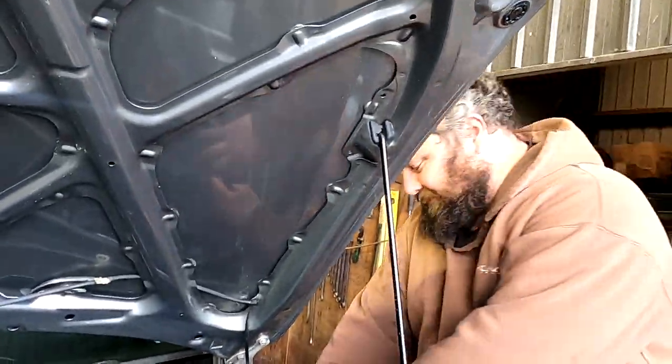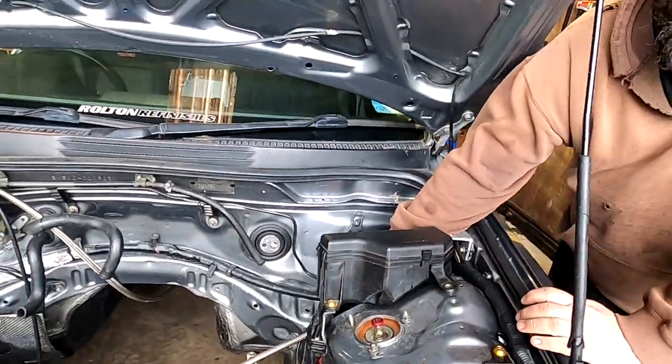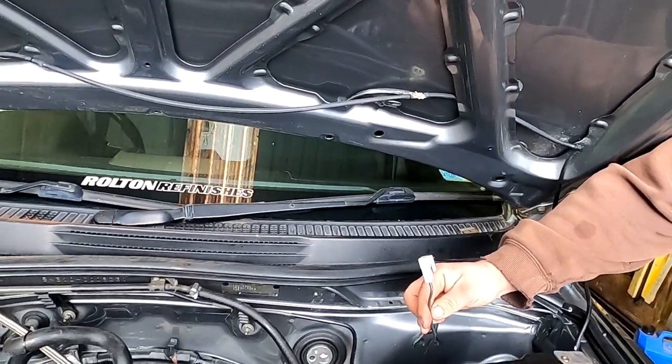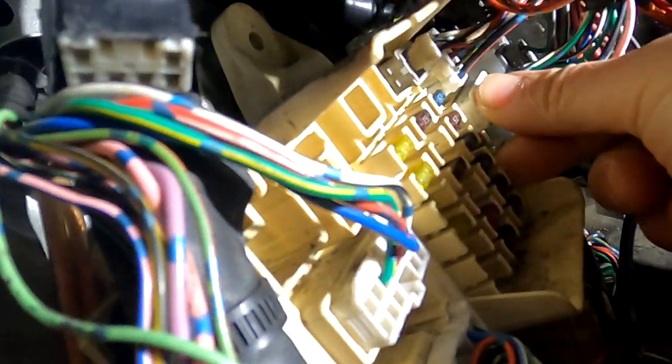He's going to cut everything out by the time he's finished. You can save on boost threshold and actually get power instead of carrying all that weight. All he's done is pull the alternator and speedo wiring from the engine bay and put it inside. There's a troublesome connector - a short one that plugs into a longer one - he had to figure that out.